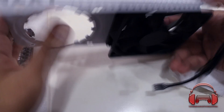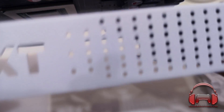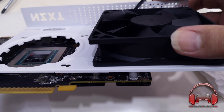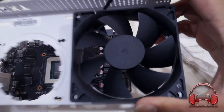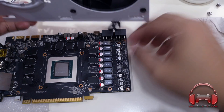What are we going to do with the G12? First of all, you need to put the fan in first before you install it. I'm doing this in voiceover, so I actually did everything beforehand. There were quite a few concerns simply because the Kraken G12 is designed for standard-length GTX 1080 Ti cards, whereas the Mini is a lot shorter. We had an issue with where to actually mount the rubber standoffs, which are supposed to go in between the shroud and the PCB. After a bit of experimenting, we came to a conclusion that you could mount them in between the pump instead of on the outside edge of the G12.